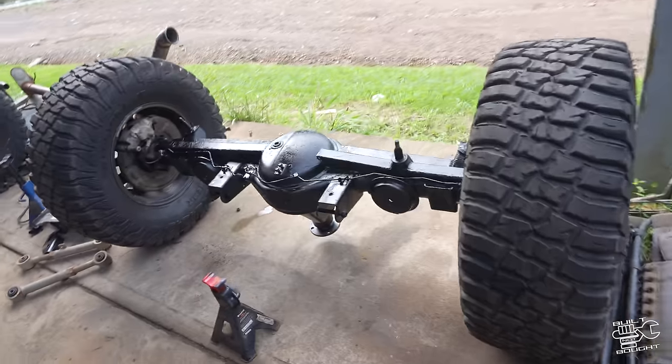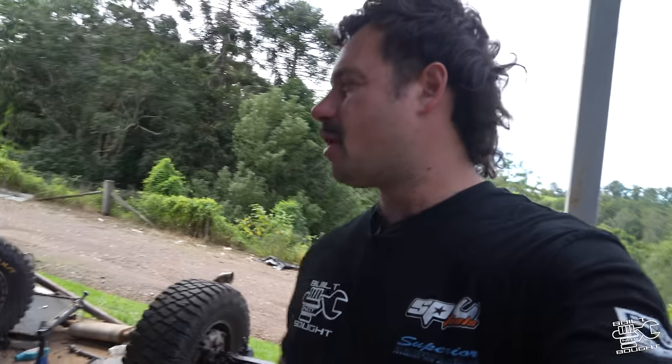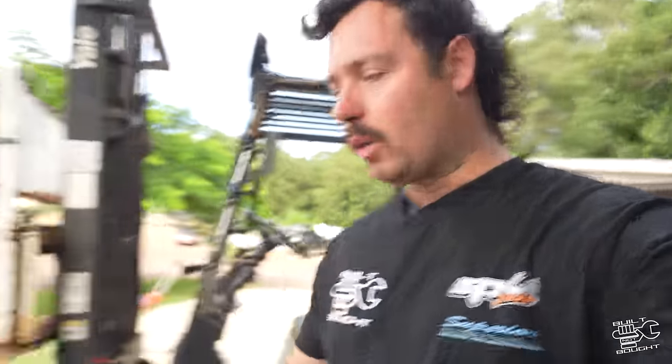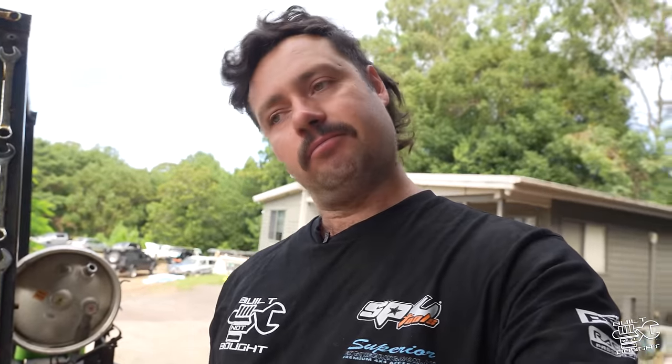The diff is done and painted. It's not amazing but it's freshened up the look. I might roll that back under the rear of the car. We are waiting on those suspension arms. I will be replacing the brake callipers and rotors — putting brand new brakes on this whole thing. Probably new hard lines too, and we're definitely going to replace all the braided lines because they're probably three or four years old now. Just for safety, we're going to replace all that. Let's let that dry and maybe this episode, maybe next, we'll roll this diff under.